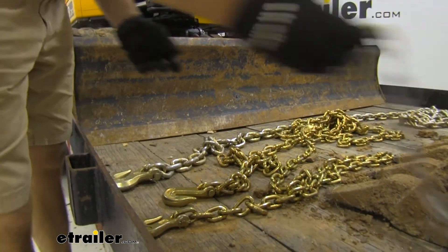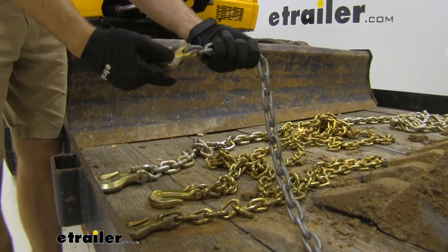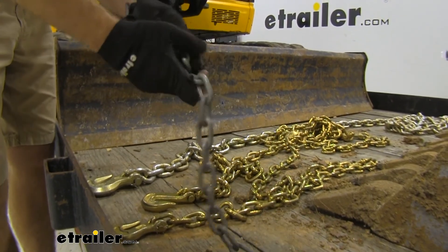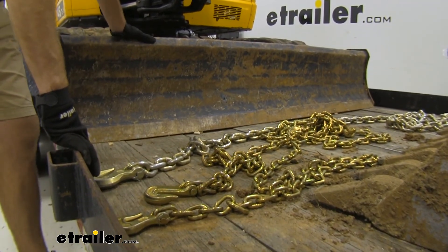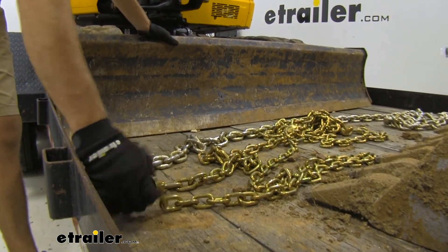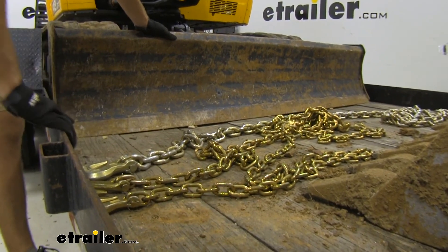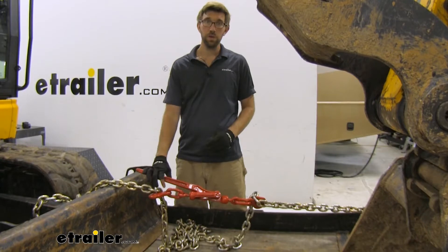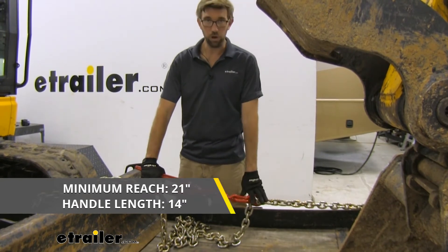This mini came in today with quarter-inch chains. If they use the proper amount of those to hold it in place to the working load limits, you're definitely going to be okay. But something you want to check before you head out is making sure you don't have any damaged links. That's something we've seen before where links start bending and things start wearing out — after a while, when chains are holding loads down and rubbing against one another, you can start seeing signs of wear, and it's just not safe. The minimum reach on the hooks is 21 inches, which we need to keep in mind when hauling loads.